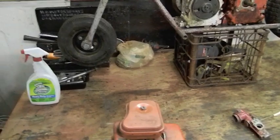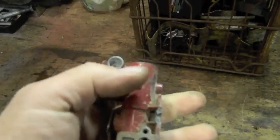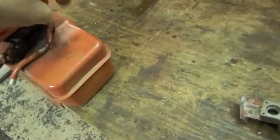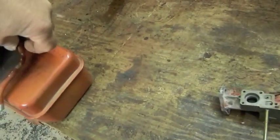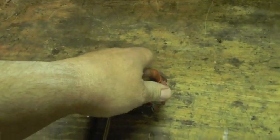Just ran back out here in the garage, it's 9:30. To answer your question, Dizzy — you're asking what this is for. This one's full of silicone; it's basically for this tube right here. The tube goes on here and then goes right into your tappet cover. The blow-by that comes out of your engine gets drawn back up and drawn back into the engine, so you have a steady airflow inside and the engine doesn't build up pressure — it actually tries to get into a vacuum.